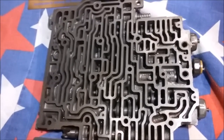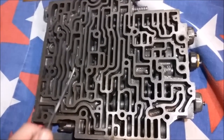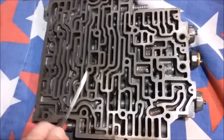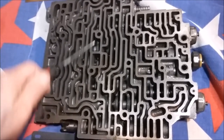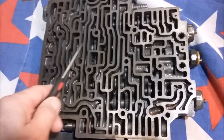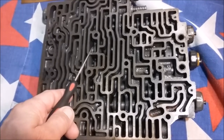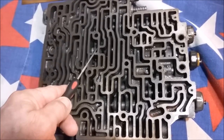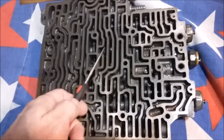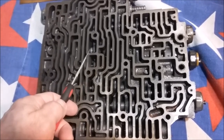The auxiliary vs. non-auxiliary distinction is actually not the most important thing you need to know to select the main valve body. What you really need to know is about the lock-up valve. Early 1980 to 86 had a steel valve in here that actually worked for lock-up. If you're doing a mod rod or kit car and want to control lock-up without a computer — just using switches and a lock-up valve — you're going to need the earlier valve body with the steel lock-up valve.